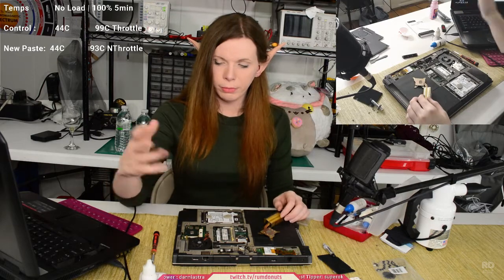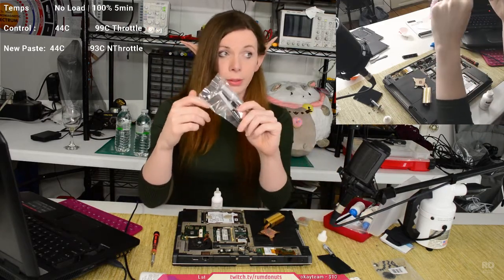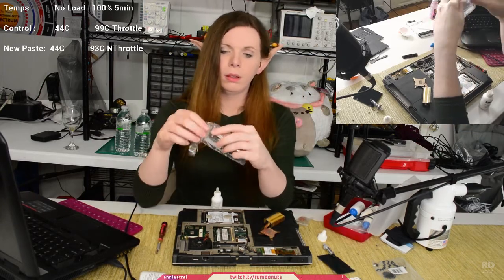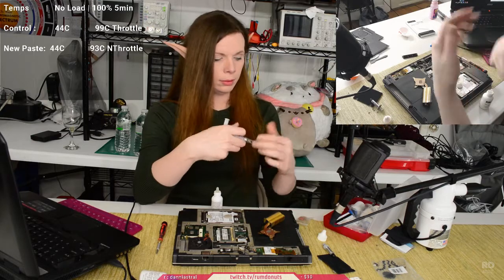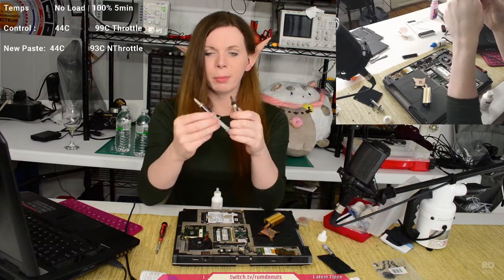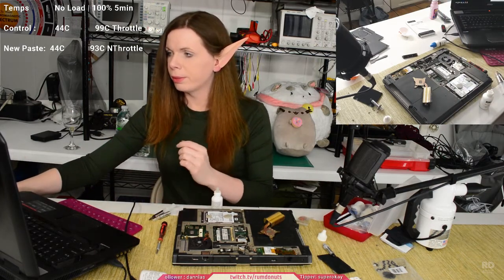Okay, so I'm gonna go ahead and remove the thermal interface material. And then we'll get to using a product I haven't used before, which is this stuff, an actual adhesive, not just an interface material. Let's use this. Oh, look, I think it tells you how to use them right on the little syringes there. For instructions, see Arctic Silver 5-minute 1-to-1 mix. I think this is probably a lot like Bondo. But I'm gonna look up the Arctic Silver website real quick just to make sure I'm not missing a detail, like you have to spit on it or something.